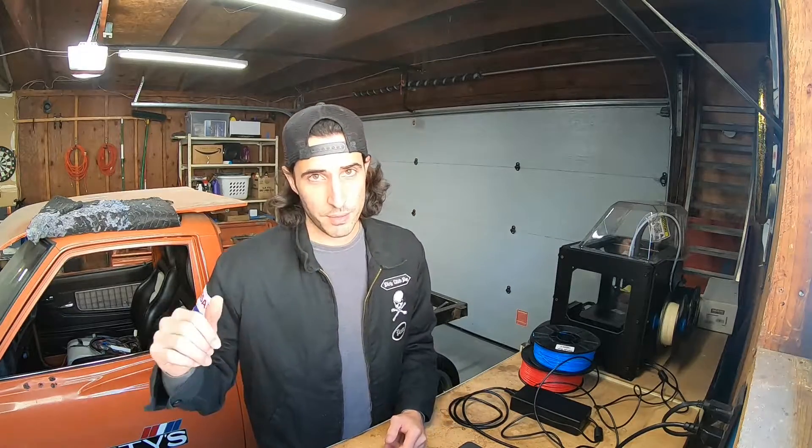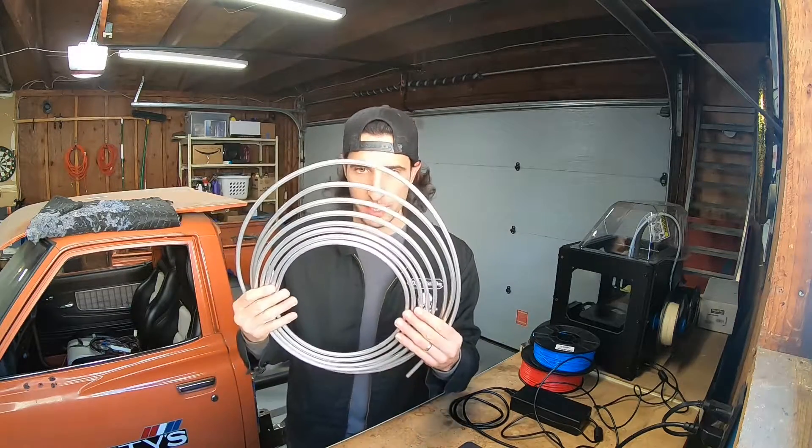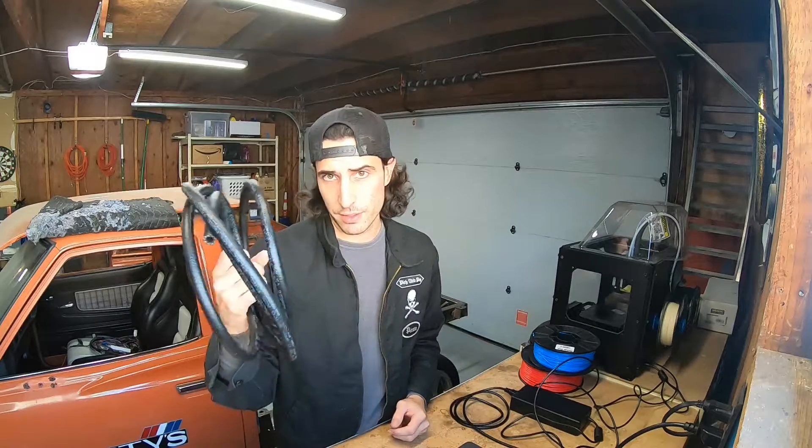Hey, what's up, I'm Mike, this is Porsche Chop Shop, and I'm super stoked about this one. I've been saving up these parts and making some things for this one for quite a while now. I'm going to be doing the fuel lines on the Datsun 620. I had run rubber fuel lines before but I'm ready to upgrade and get rid of the fuel smell. I got five-sixteenths aluminum line and five-sixteenths rubber line that's fuel-injection rated.